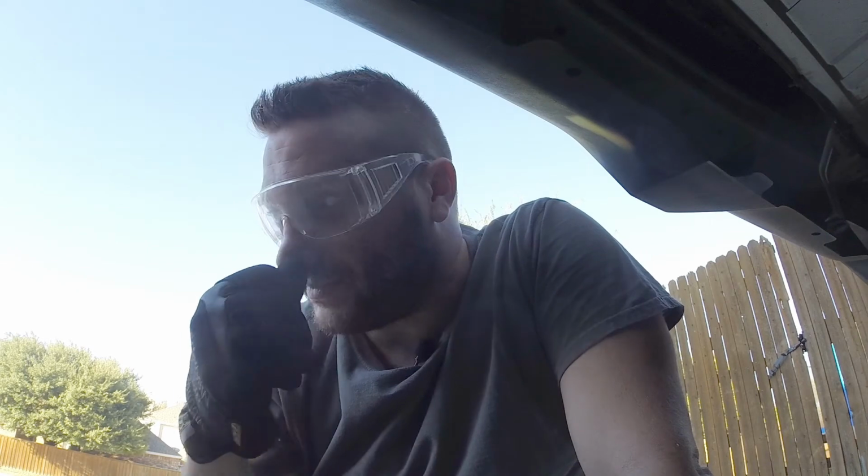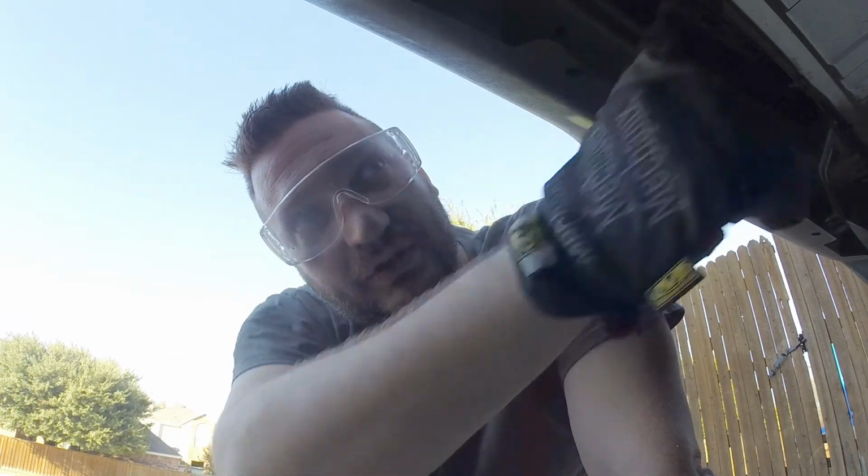If not, what I'll do is bring them this piece I hacked off or get them to bend their own pipe. And then I will have them maybe just pull the tips off the old exhaust, and we'll just run pipe and then run those tips all the way to the old spot. With none of the baffles on the old muffler, it sounds fantastic. It'll also hit full boost, which was actually my main concern. The sound, while I do enjoy a nice throaty Subaru rumble, was a lot less important than making sure that I was getting full boost.